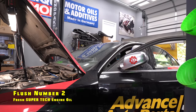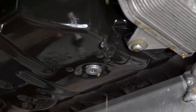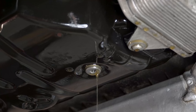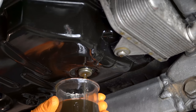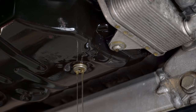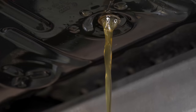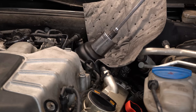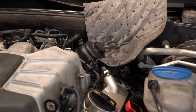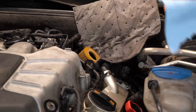Round two. That's flush two also. Check out how much oil actually leaks when you shut the car off, because all that oil is now just sitting at the pan. Let's get our drain plug cracked loose and grab another sample. That looks so much better. We're still grabbing a lot of contaminants out of the engine, but wait till you see what this looks like directly compared to that last sample. I did not replace the oil filter between flush one and flush two. Let's take the oil filter out and see what it looks like — maybe we run no filter at all. That filter's super clean still. I think we're gonna run this one for the final flush, and then we'll put a new filter in when I do the final fill up.